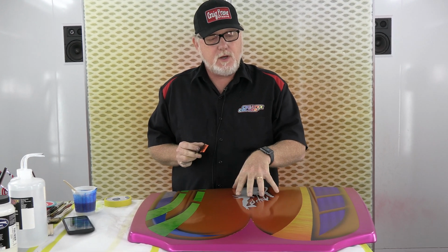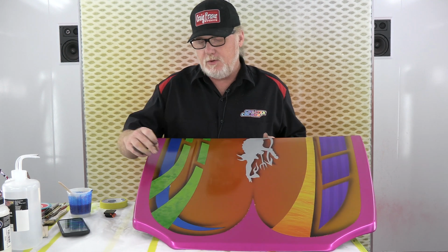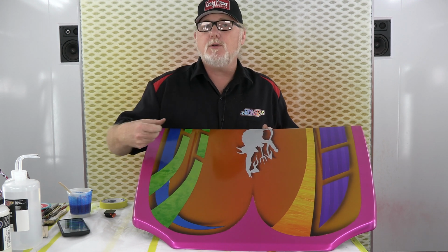Okay, I went over the whole design using my edge scraper. We're using the plastic blade. Now, I think Chris put a little bit of heat on this just to dry it last night, and the only thing I'll recommend when using the edge scraper is to get to it before you heat it, because it works best when the paint isn't wet or soft, but when the paint's really hard, it's a little bit tougher to use the scraper. A little bit cleaner on here. But you can see there's a couple of areas where you may think, oh, it dug too deep right here. There was actually a piece of tape stuck underneath here that caught, so the edge scraper will also help you catch the tape. Now, some people think, well, if the tape's buried, leave it.